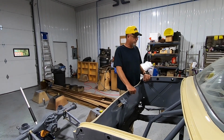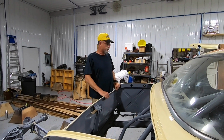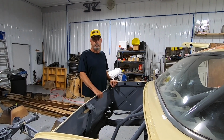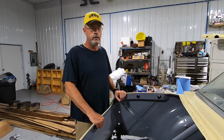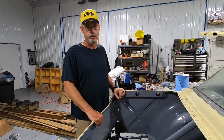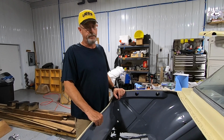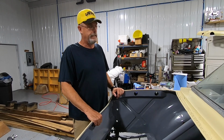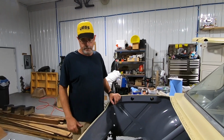But you know what it boils down to is we're still starting out in the hole pretty bad, because the Volkswagens are capable of, we know, at least 1.5 horsepower per cubic inch. By one of the other guys, by his own admission, that's what I figured it up. He's making 1.52 horsepower per cubic inch. Now, that is not impossible with the AMC Jeep 6-cylinder, but that is a stout engine. That's a stout combination. Yeah. It's hard to do that with a non-cross flow head. So we'll see what happens.